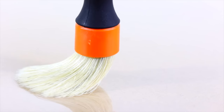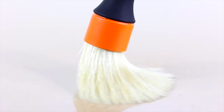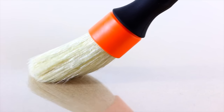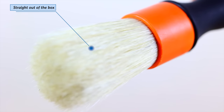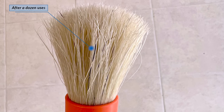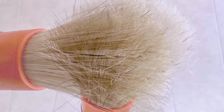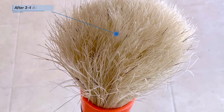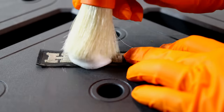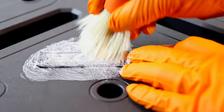The first thing you need to understand about this brush — and something I actually underestimated — is that it has a substantial break-in period. I've owned quite a few horse and pig hair brushes in the past, so I know they take a few uses to break the hairs in and get them working optimally. But with this brush, I'm still finding that after three to four dozen uses, it's still getting better and better after each use. Straight out of the box it's a little stiff, aggressive and really doesn't clean, foam up or perform anywhere near as well as it does after a few dozen uses — it feels and works like a completely different brush after that break-in period. My advice is to break it in on less aggressive materials like carpet, upholstery, rubbers and harder plastics first, and then after that period it'll not only clean better but also be gentle enough for more sensitive surfaces like leathers, softer paints and more sensitive trims.